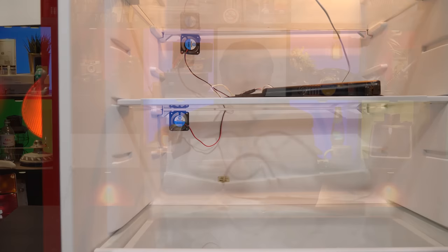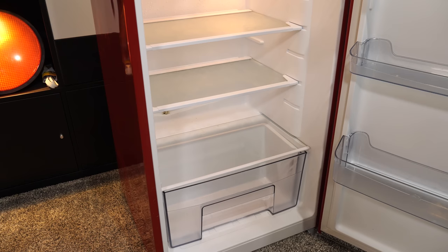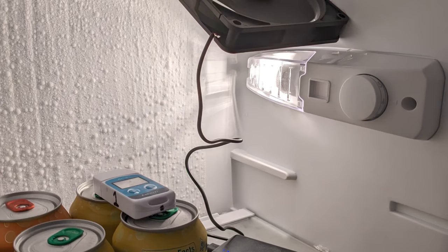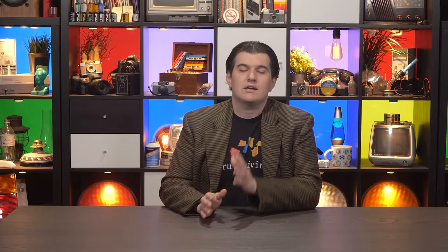Speaking of fans, the fan experiments likely wreaked havoc on the overall setpoint because the new airflow patterns — even though they may have been minuscule — kept tipping the balance between the internal chilling effect on the sensing bulb and the fridge's actual temperature. More airflow near where the sensing bulb sits would skew its reading towards the actual air temperature and diminish the importance of the internal chilling effect. Also possible was that in tests where lots of air was blowing on the evaporator, the internal chilling effect itself was diminished as the refrigerant vaporized more completely in the evaporator. But honestly, I'm not super confident in those explanations. All I know is adding the fans made really weird stuff happen and it's not gonna help.